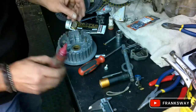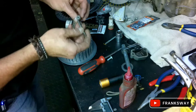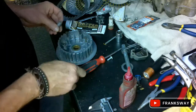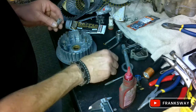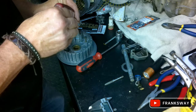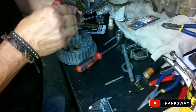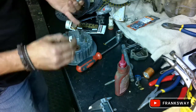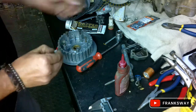We're back. I managed to tap it through completely. I've got a bolt from the back and I'm going to put some Loctite on here. I can't have this bolt being too long for a simple reason - the bolt is now going to be screwing in from the bottom to hold the long piece, and then I'll have a bolt from the top that actually holds the springs from the clutch basket.